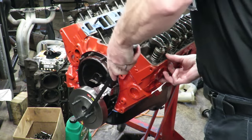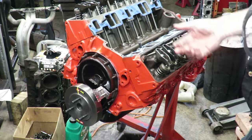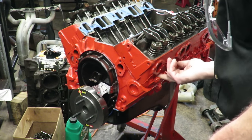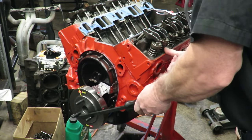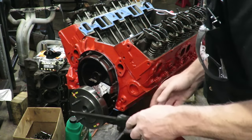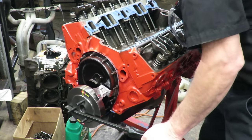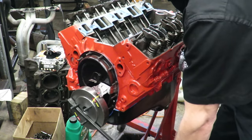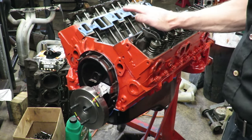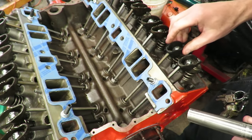If that's the case, go one more revolution and bring it around. You'll hear compression again — in fact it actually pulled the motor over because the pressure stopped the crank from turning. We're almost to TDC and you can hear that compression. We'll bring this around and put our balancer mark right at the tab mark. Now our valves are ready to adjust — we've got our balancer on top dead center compression.